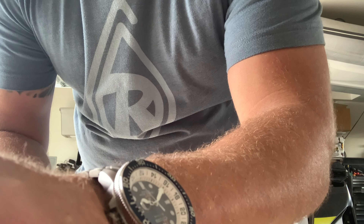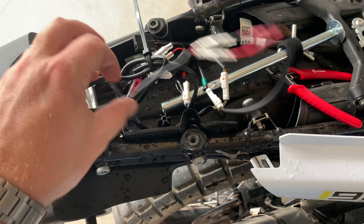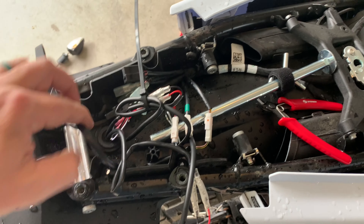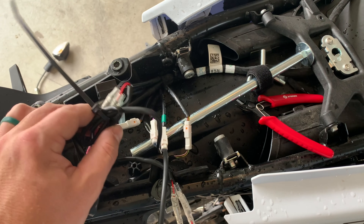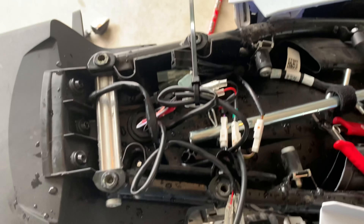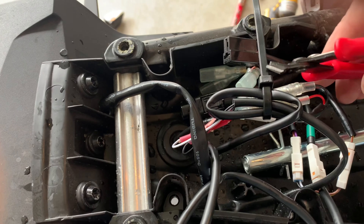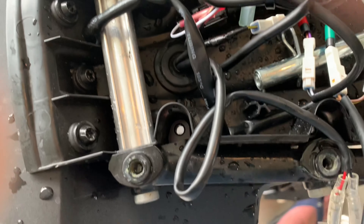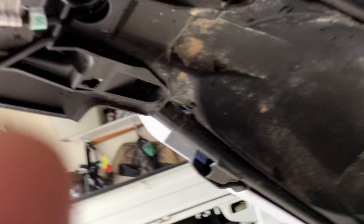Feed the light and washer into the bike and thread on the other washer on the other side — the nut. Don't forget the waterproof gasket. Instead of leaving the wires like a mess and just cramming them in here like you see on a lot of people's motorcycles, do yourself a favor — spend time doing it. Just zip-tie them together, neaten it up a little bit, and that way everything stays nice and clean. It's a great tool — you can see how flush it clips off — highly recommend it.